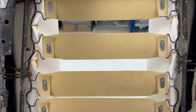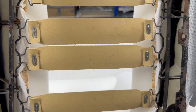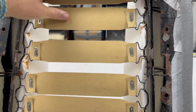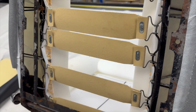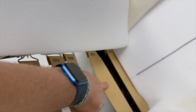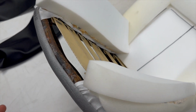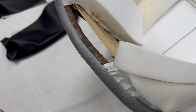The webbing we supply is really strong stuff. It's the Pirelli webbing, really robust, a lot stronger than a lot of the alternatives that people offer commonly on the market out there, and we've done that on purpose because you want this to last a lifetime. The idea being that they are tight as a drum when they are fitted. They're going to ease up over time, so you want to start as tight as you can, and therefore you really want to be pulling and straining from left to right on those things.